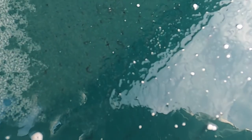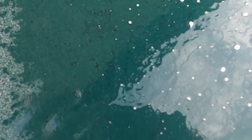So this is just a little breakout video with the fallout spray removed, and see all them little bits there, all the dark bits, that is the chemical working, they're going red. There's a few more bits there, so that's a little bit of iron, the chemical reacting, turning it red. That's attacking the corrosion, reducing the size of that embedded iron in the clear coat.